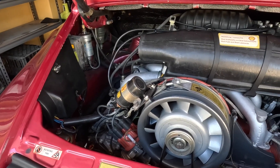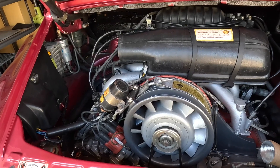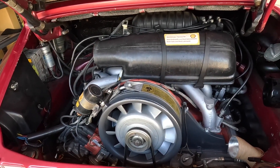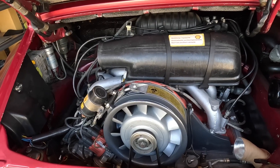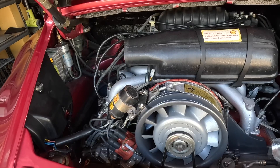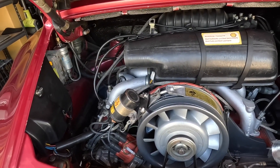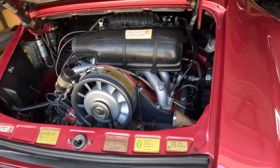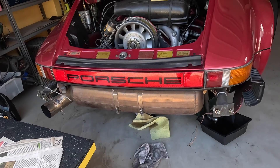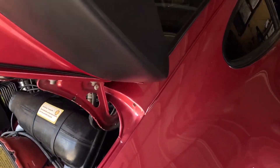It has been rebuilt once before and it was upgraded to a 3.1L using 97mm turbo barrels and some aftermarket pistons, which are the Max Moritz wedge style domes. Apart from that, the warm-up regulator and the fuel distributor have been rebuilt and this runs beautifully. It's got a Monty muffler and a set of SSIs on it as well.